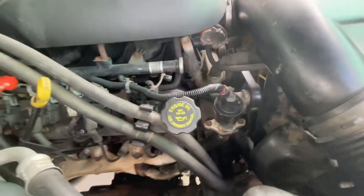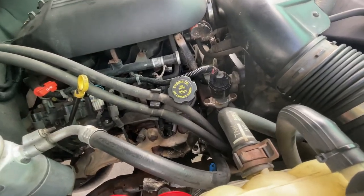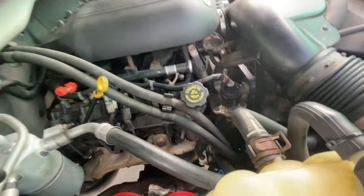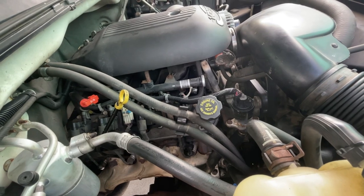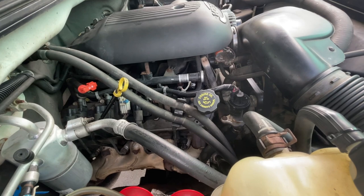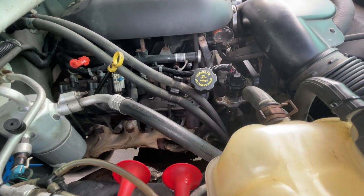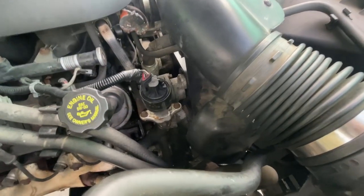Here's the best news: I don't have the dread of ticking anymore. After I drive it around for maybe a tank of gas, I'm going to make sure all the cinch bolts are still tight. Here's another good thing: the service engine light had been on for years on this truck. I had an EGR valve code — I did everything: cleaned the EGR ports, even replaced the EGR valve a few years ago, and nothing got rid of the code.